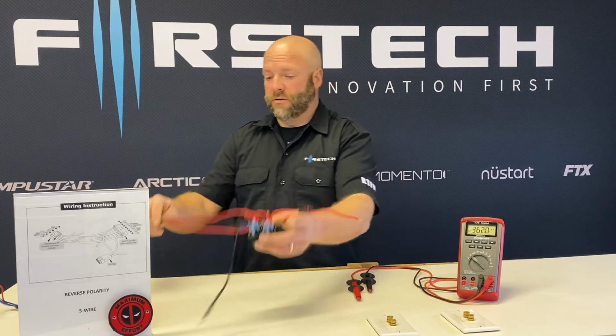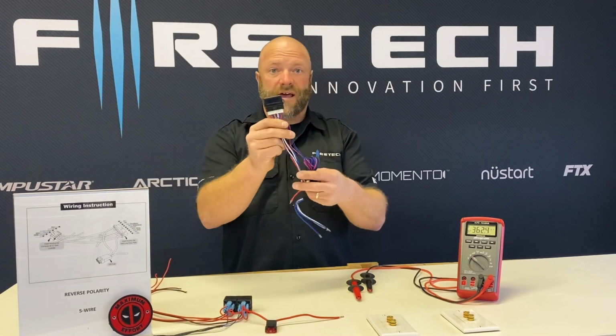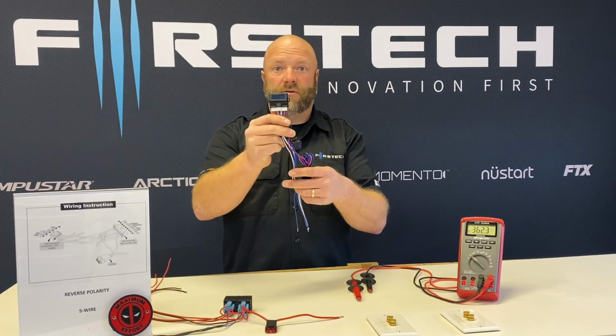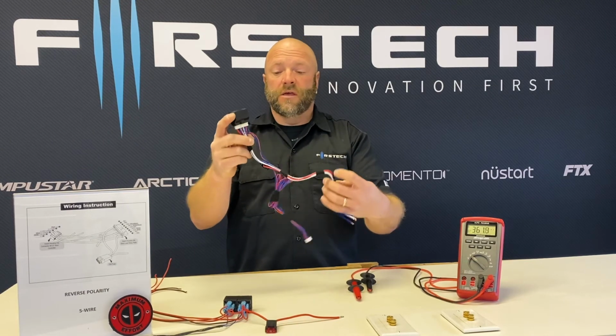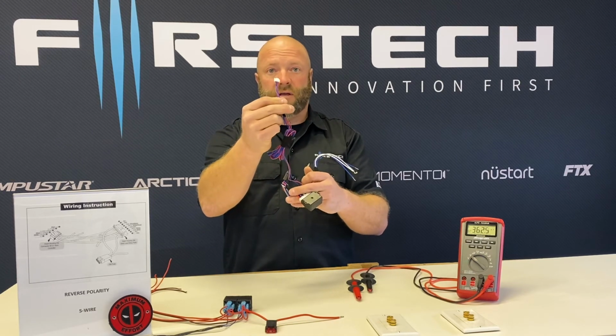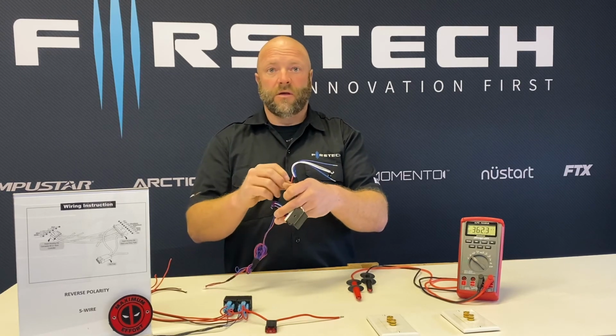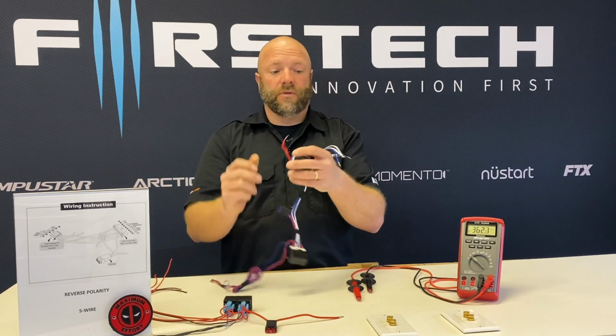5-wire door locks. The other way you can do that is with a DM700. This is an FT DM700, a relay pack. There's 2 high current relays inside this box. It gives you a pre-wired 6-pin lock harness built right into it. This just plugs into the brain. You feed constant 12 volts to this fused red wire.